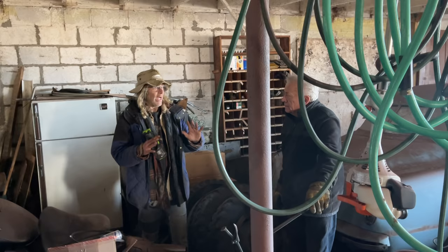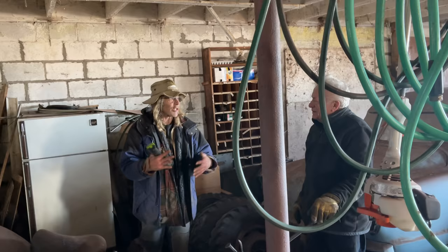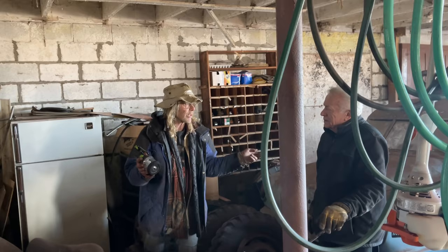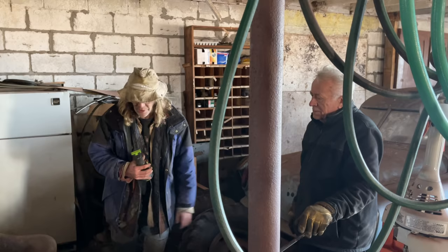So I had troubles with the drain plug soldering job. I'm not good at soldering, so it kept dripping, so I got mad and cut it out and welded a plate there. Then I bought extra gaskets, and I figured, every few hundred miles I've got to adjust the valves anyway, because they seem to be loosening all the time. It's got all new valves, all new guides. Alan Armstrong did the crank, new bearings. The connecting rods had pistons put on, and they were straightened at International and Nova in Dartmouth.